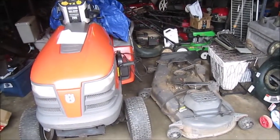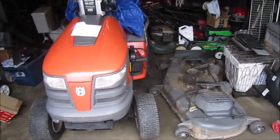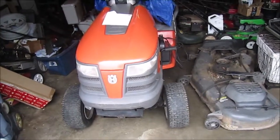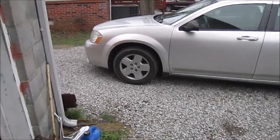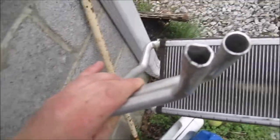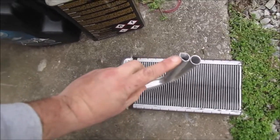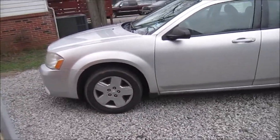Hey folks, welcome back. Sorry it's been a while — I haven't been posting videos like I should because I've been dealing with some stuff outside of work. Working on things — my silver Avenger right there. The heater core — I messed up trying to replace the water outlet on it. That's the heater core right here and I bent that part right there on the left. I broke that and it was leaking cooling inside my car real bad, so I had to replace the heater core.